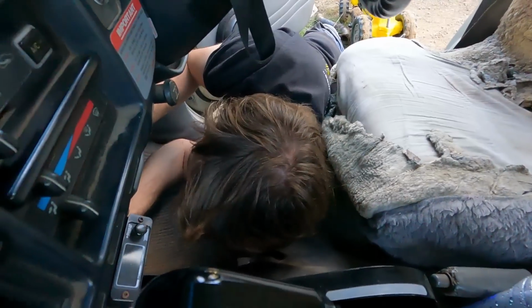If we start the dyno back up, we could find the graph. Oh yeah, we probably could actually. I forgot that it's on that dyno. But anyway, the point is that because of the restrictions in the exhaust housing, and the way we've sized the turbos, it does dive. What we could do if we put an RPM reference into the e-boost is jam some more duty cycle into those higher RPM areas. That way we could maintain that 14 pound across the whole rev range.